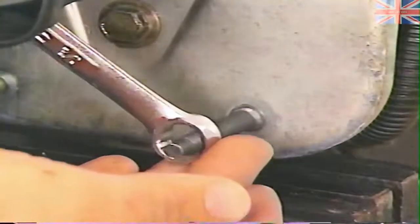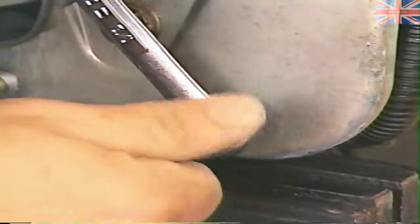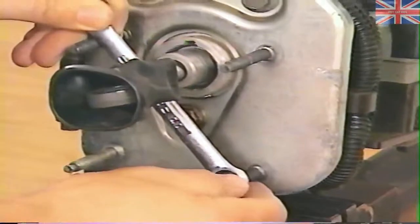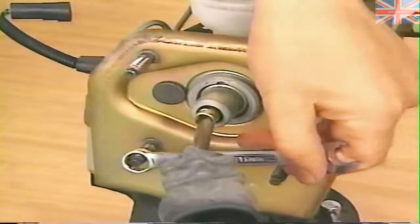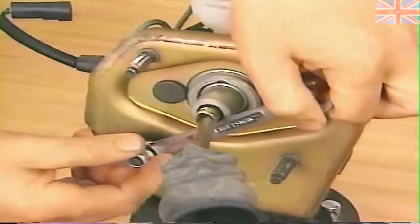Next, place a half-inch box-end wrench over the lower mounting stud and loosely install a nut. The wrench should be aligned in the 10 to 11 o'clock position on the input rod bearing for the Antilock 10 hydraulic assembly. If you're working on an Antilock 9 assembly, the wrench should be in the 1 to 3 o'clock position, as seen here.